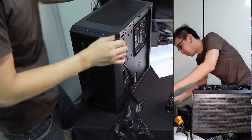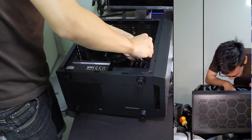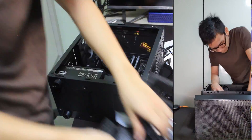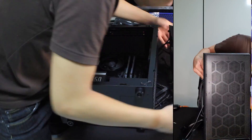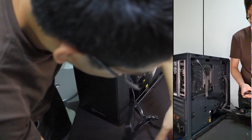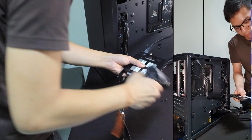Now we are just doing some cable managing. We are connecting the CPU EPS power now. It's a bit of a hassle. What I will do in future builds is, after I screw down the motherboard, I will connect the EPS power first — actually the motherboard 24-pin comes first, then the EPS comes second. After that, remove any extra panels if necessary as shown. Connect all the cables properly, cable manage it, and make sure it is neat. Most importantly, you don't want to have any loose screws hanging around inside the case, because loose screws might touch two metal contacts and short each other — and basically what that means is you have a very nice looking showpiece that doesn't actually work.